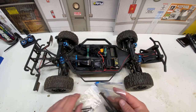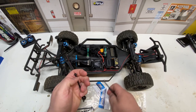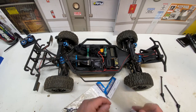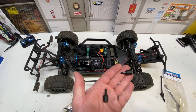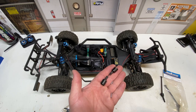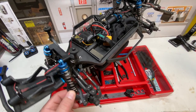These particular drive shafts require quite a bit of disassembly to get them in. You get the CV shafts pre-assembled and they feel really nice, but we're going to re-loctite the set screw and make sure everything is good. The reason installation gets complicated is we have to tear the diffs completely out, drain the oil, replace the cups, put them all back together, and refill with fluid. We'll go through that step by step. First, remove all the wheels from all four corners and get it up on the workstation.